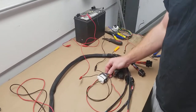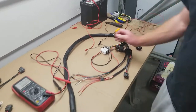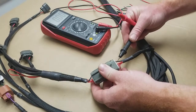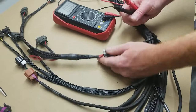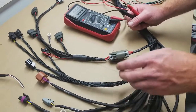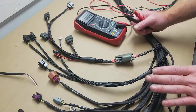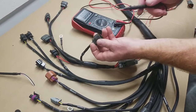I've got ignition power and ground going into our interface, like you've seen in some of the other videos. On this SR20, we'll take a look at the coil breakout — that black with a red stripe is going to be ignition power. All of the components in the harness are powered at the same time. It's a bus power design, so items like your coils, your injectors, your flex fuel sensor, boost control solenoid — they'll all be powered with the ignition circuit. So if one has power, all of them should technically have power.